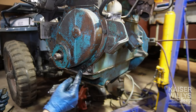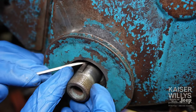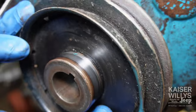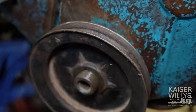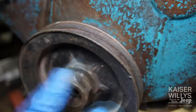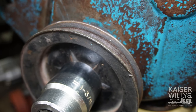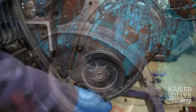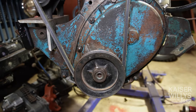Also take note these are a little bit shorter because they'll come up and hit the studs. Final step is to set the woodruff key in the groove — try not to drop it down in. It should be level. Make sure the surface of your pulley is nice and clean, line it up, and slide it in. Put your nut on. I have yet to find an actual torque spec on this nut — I usually make mine to about 120 foot-pounds; an impact works better for me. Reinstall your belt, put tension on it, refill the engine with oil, and you're done.